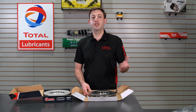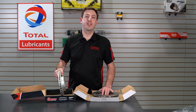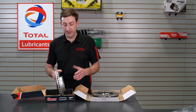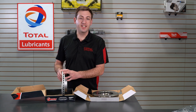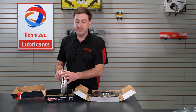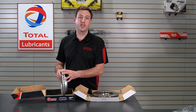Which rotor is best for you? The uncoated rotor is better for a vehicle you're trying to sell, trying to get rid of, or just trying to get through another winter. The coated rotor is much better for Canadian climates and northern USA climates with the salt. It has a GeoMet coating that really absorbs into the cast iron — since cast iron is porous, it accepts the coating really well — and these have been salt tested for many many hours to refine the coating.